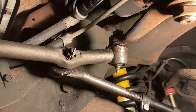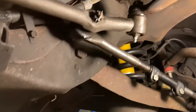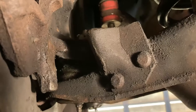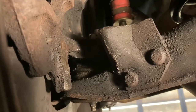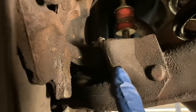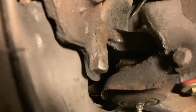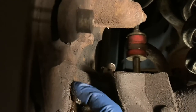So here's another trick. Take your finger and scoop up all this extra grease that squirted out. Yeah, like that, just to get a blob of it. And you can scoop it out from just about any place. I mean, ball joints, things like that, ooze grease out. And you come over here. And right here is the steering stop. Now, if you're ever driving one of these cars and you turn it hard to one side with the steering wheel to the lock, usually when you're at the lock position, the steering knuckle is up against this stop here. So this is your steering knuckle and this is the stop. And you can see it does make contact with that. So what you want to do is take that grease on your finger that you got and just smear this excess grease a layer on there.